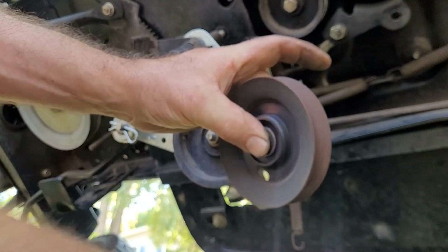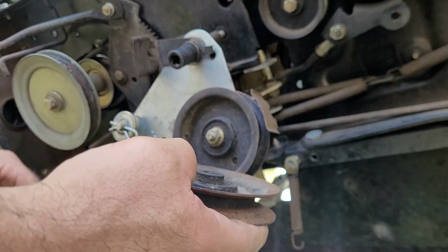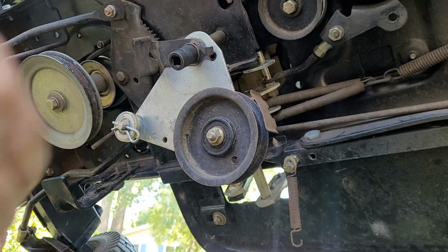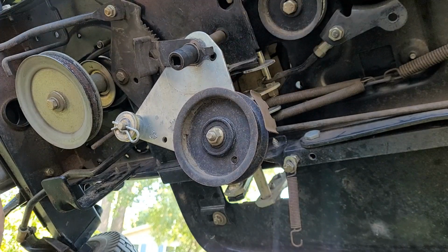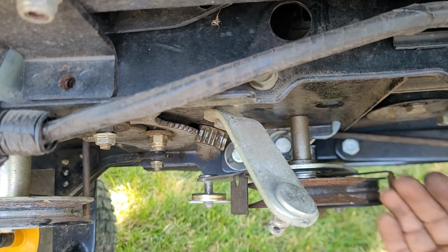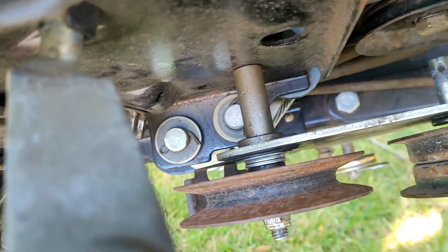Okay, so this pulley, good. We just need to shim. I'm just going to use washers because they're adjustable, but probably what was on there was a standoff or another piece of this stuff cut to length, but I don't know what the right length is, so I need to look when it lines up to get that belt riding in the middle of that pulley. Let's do that. Okay, it doesn't want to focus perfect, but now we can see that those pulleys are in alignment. This one's pretty good, and better yet, it doesn't flip-flop up and down.